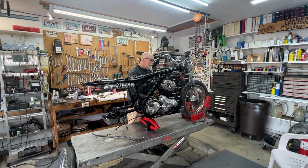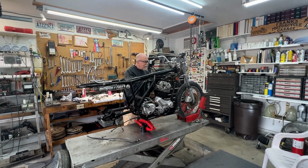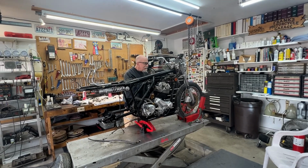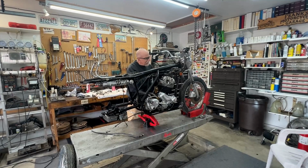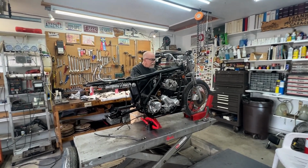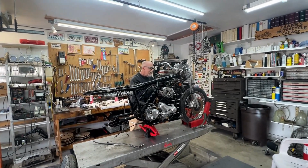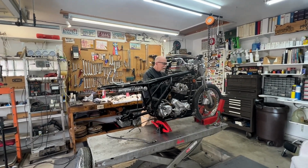Second thing he was upset about is all the 850 owners, such as me, who took off our 850 pipes with the crossover and put on 750 pipes with no crossover. He said, but they run better with a crossover. And we said, we know it, but they're so ugly. And the poor guy, he did all that design work, and we thwart him in the afterlife.